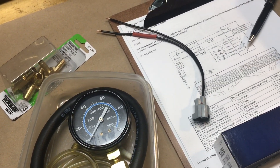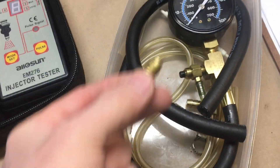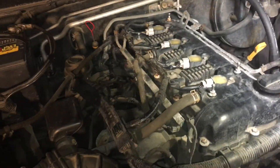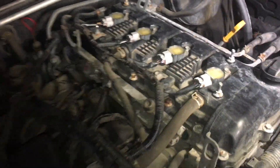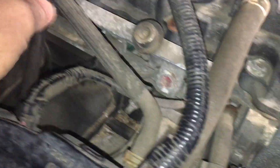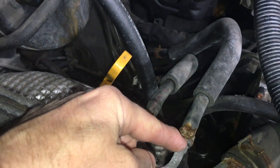I bought myself an adapter for the injector just to make things a bit easier, a couple of T-fittings to cobble everything together. If you're lucky you'll have a Schrader valve on your fuel manifold that you can couple to — I've never had that kind of luck. My test subject today is my Vitara. It's a four-cylinder 2.4-liter engine with four injectors easily accessible on the fuel rail. We're going to couple into the supply line here — this is a returnless system.